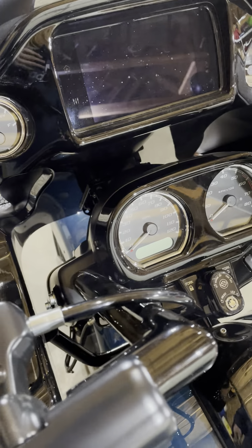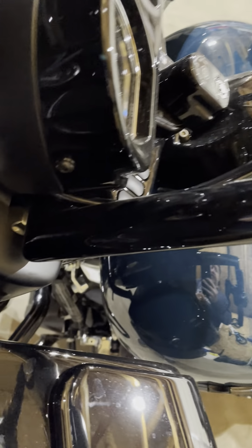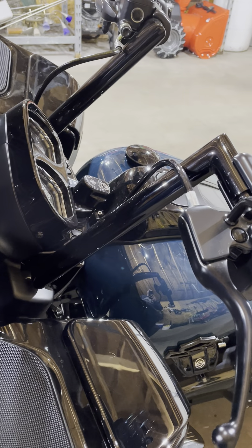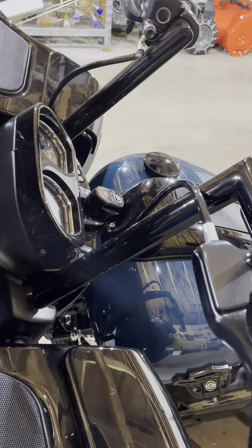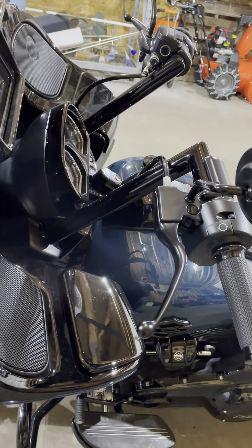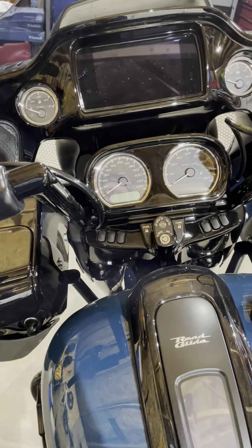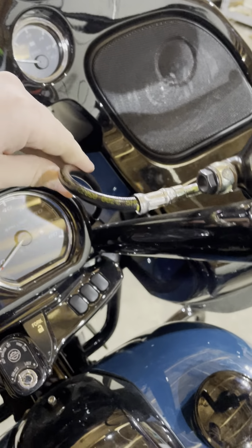Running the lines through wasn't too bad. You have two 90-degree bends — one at the top and one at the bottom — and then a center hole for your wires to come out. They don't give you any kind of Chinese finger-lock tool like the KST bars do, so I basically ran some fishing line up through the bar, taped my fishing line to the internal wiring with electrical tape, and pulled it through. You'll have to rig something up for that.